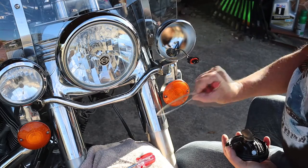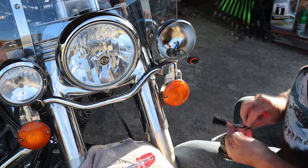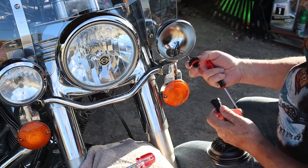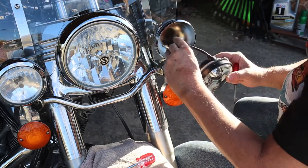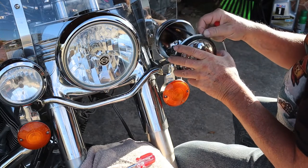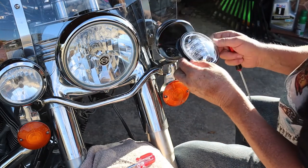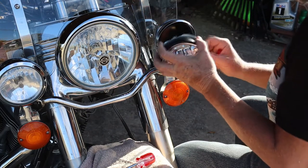You have to reuse the ring. Slide the ring back on the new light. On the new headlights you've got a black and a red wire. On your connection you've got a gray and a black — so black goes to black and it fits and snaps. I've got my ring on, you've just got to finagle this back in here, get this ring worked around. The important part to remember is that the DOT SAE marking on the light goes up.